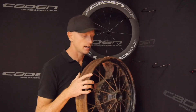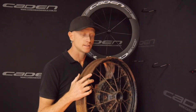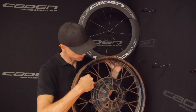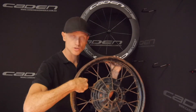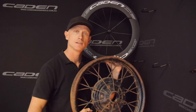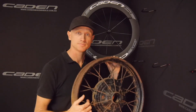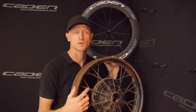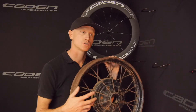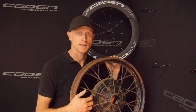Henry Ford was having issues with that, as a lot of road bikes do, and decided that because there was an offset from this side to this side, he'd run twice as many spokes — you can see there's two then one, two then one, two then one — twice as many on the inside as on the outside to balance the wheel. I was taught this spoke pattern in France in 1997; they called it triplet lacing. The Italians call it two-to-one ratio, which you're probably more familiar with.